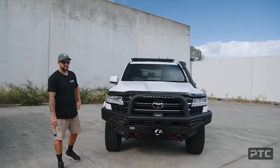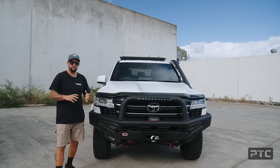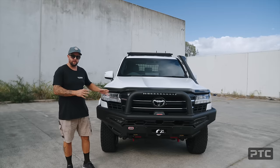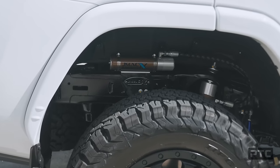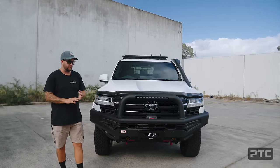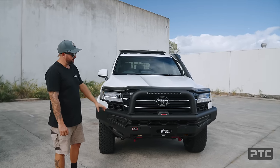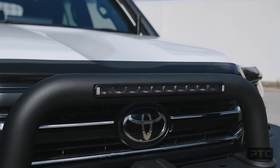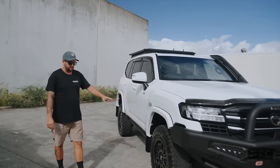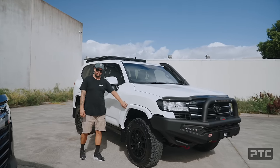G'day guys, Chris, Pro Touring. So here we've got a GX 300 series. The GX is the very base model for the 300s — entry level, we're talking vinyl floors, cloth seats, things like that. Not a worry though — all our gadgets and things we do with Pro Touring, we can spec them up. We've got the JMAX 4200 pre-rego GVM upgrade, federal compliance on that, which does maintain three and a half ton towing, so you're at full capacity — a 7.7 combined mass. We've got our ARB bull bar in Pro Touring UV powder, the integrated ARB light bar, and a Warn winch. This is the Sahara bar — you'll notice no hoops coming out the side like the VX had. We're running the King off-road wheels with 285 tyres, and extended flares to cater for the bigger wheels.